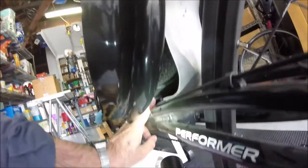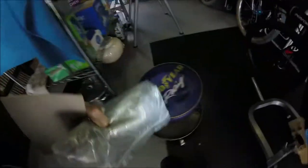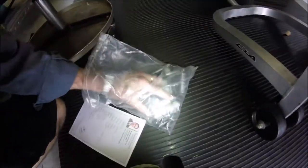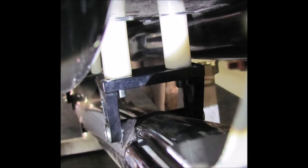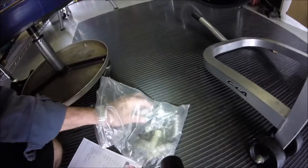This bike is great for seat height adjustment. These pivot points are just mounted with 8-millimeter bolts. You can see it better here on the front along with the spacers I've put on them. I've got a whole kit of nylon spacers that let me fine-tune both the front and back of the bike. I've even made it into a mid-racer configuration at one point — I can adjust it any way I want.